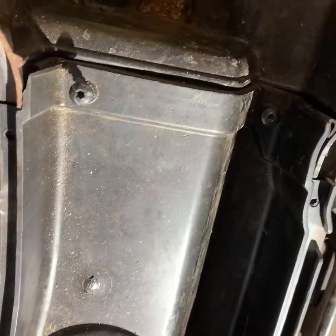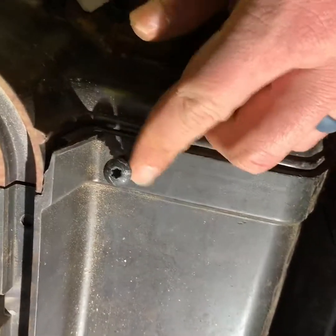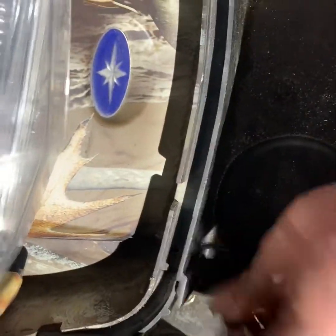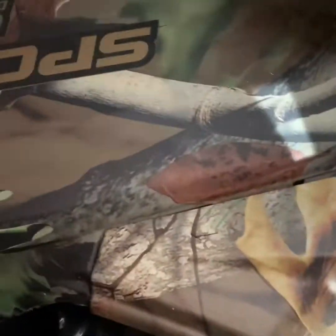To get in here to the fan and all your cooling and electronics, there are four screws here on the front right inside the tray. You have to take out one here, here, and here. This lifts out, and then you have to kind of pry these out of here, pull the sides out, and there are clips in there that will come out, and this whole piece will come out for you.